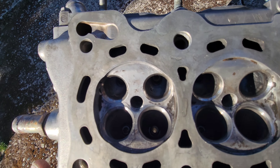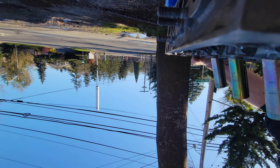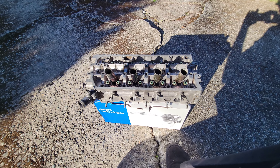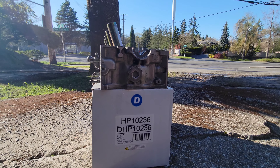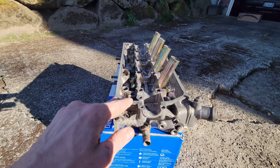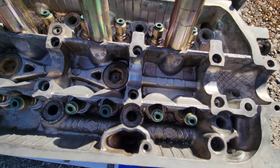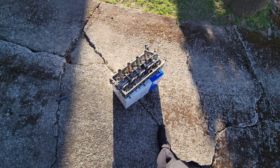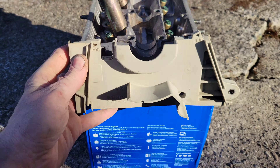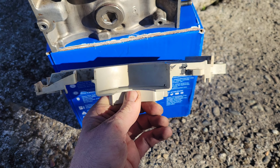There's the back of the head. I still got a little bit of some touch-up spots to do, but I'm just gonna let this sit in the sun and dry out. I'm happy with how clean this came out. Hopefully the Easy-Off is okay — I was a little scared because it started to turn this crazy blue color and I was afraid it was gonna oxidize the aluminum, but it looks all right. Also went ahead and got that timing belt cover cleaned up. That Easy-Off works awesome, but the cover is a little bent — it's askew. You put it on there and it looks askew.